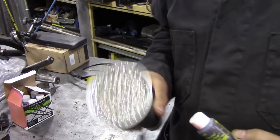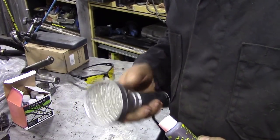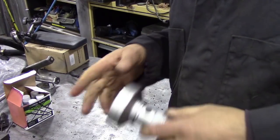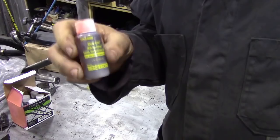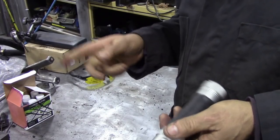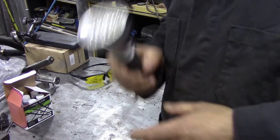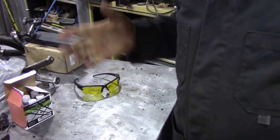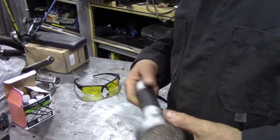You use it in combination with a UV light. This one's a particularly big one and it wasn't the cheapest, but I use it for AC and all sorts. For you guys you can just buy a very simple push flashlight, it's very cheap. You can usually get a pair of yellow glasses with it, which exaggerates where the leak is coming from so you can see the green glow as it's working.